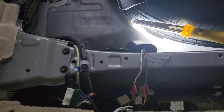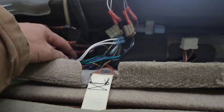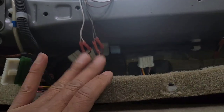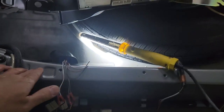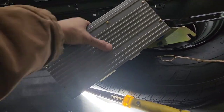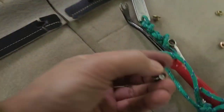The amp behind the seat right here is where you're going to have to bypass this. Because this is Nakamichi brand, the factory amplifier must be bad. So they hardwired and ran it to the back where the amp is — I'll show you where the aftermarket amp they installed it at. To take this out, it's not easy. You got bolts: one, two, three right there, and then one, two, and three on the top — one, two, and three down here. You got to take all that out.